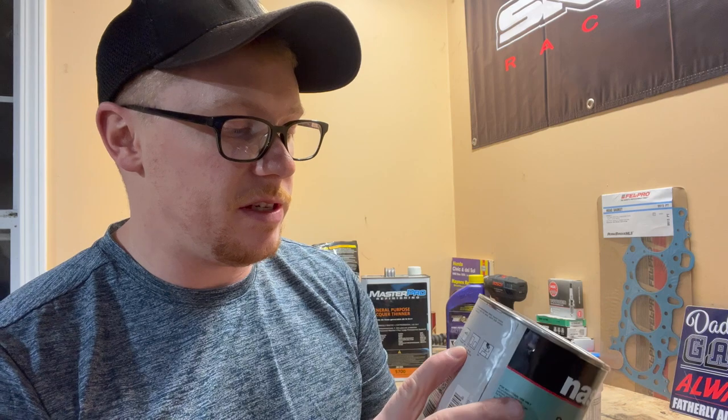I'm going to let this flash off a little longer and then mix up some clear coat — I am done with this thing for tonight after this. It's probably about 2 o'clock in the morning. The mixing ratio is four parts clear coat to one part hardener. Using these handy cups: fill it to say three on the clear coat scale, bring the hardener up to three on the hardener scale. That's basically it in a nutshell. Let's get this mixed up.